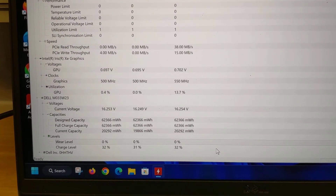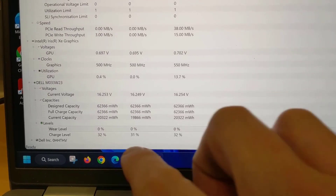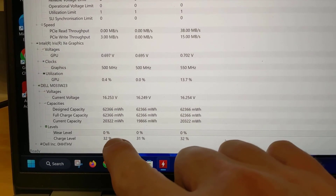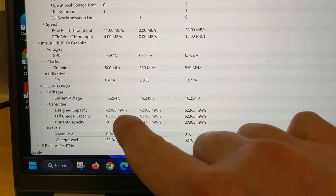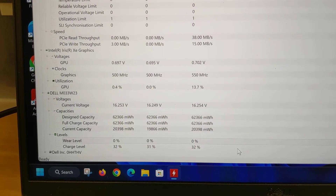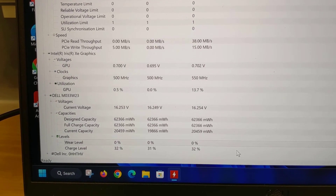You can also see the health of the new battery reflected in the Hardware Monitor program I showed earlier. In this case the wear level is now 0% and the fully charged capacity and the design capacity both match. This laptop is now good to go and ready to be imaged and put in the hands of one of our users.